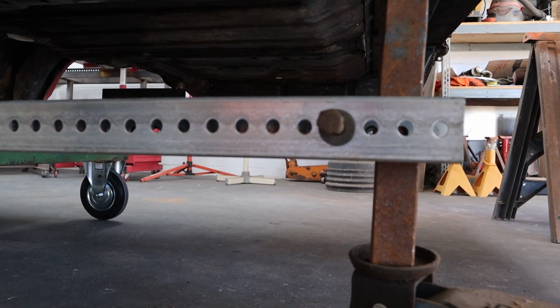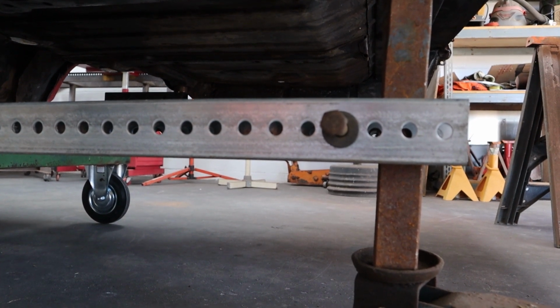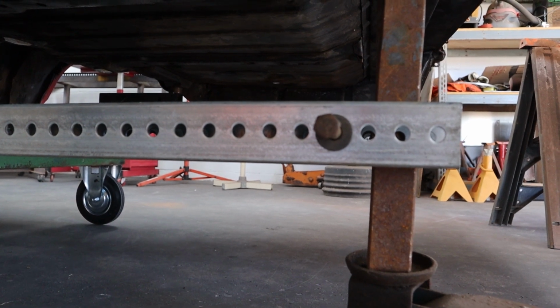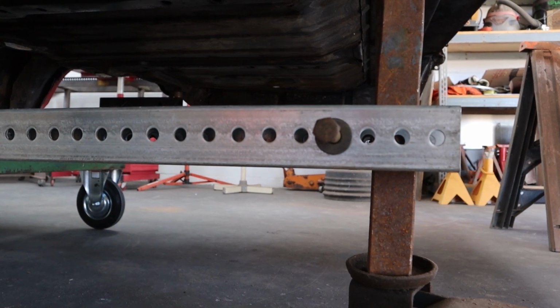And then I'll take some measurements to figure out where everything's at right now. Later, once we get all the quarter panel off, we'll take a measurement again to make sure it hasn't moved dramatically. It's not rocket science here, guys, but you don't want to be fighting something and then trying to figure out why body panels won't line up when ultimately the whole body has moved, or the structure underneath.